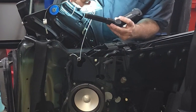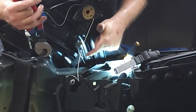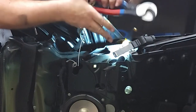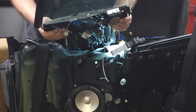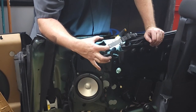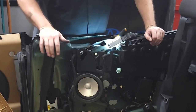I've got new ones of these coming as part of the rebuild kit — I'll bust it anyway, right? Cable cutter — see this cable is tight, and that's what's holding the window down because it can't lift. If I lift this one, the other has to go that way and it can't go nowhere. There we go — window up! Now I can lean it this way and that plug right there was catching down there. The whole rebuild kit with the new springs, new pulleys, all new cables — was $19. So I got one for each side; 20 bucks a window to fix them — no brainer.